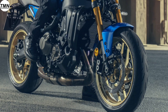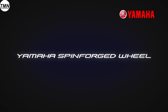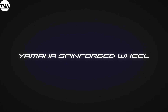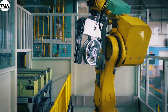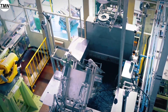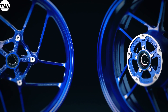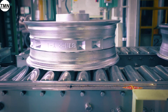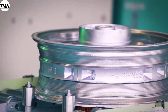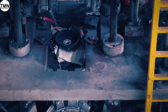The aluminum 10-spoke spin forged wheels are claimed to be Yamaha's lightest ever. Using Yamaha's exclusive spin forging technology, it has been possible to make the front and rear wheel set 1.54 pounds lighter than before. This is a significant reduction in unsprung weight that allows for more responsive suspension action, increased agility, and stability. The lighter wheels decrease inertia at the rear by 11%, making the new XSR900 feel even more responsive when cornering and braking.